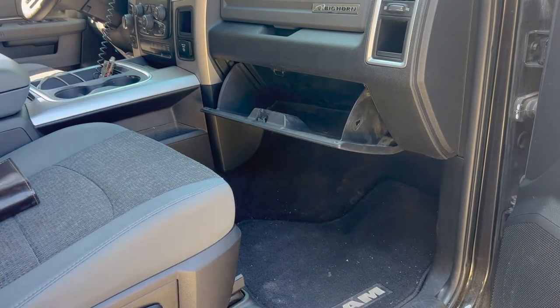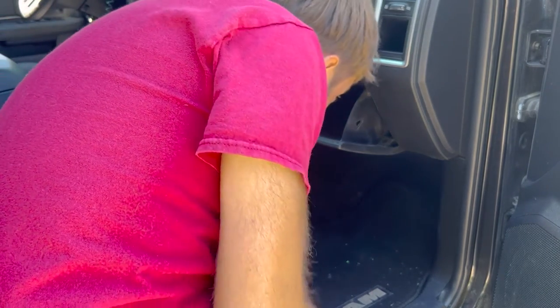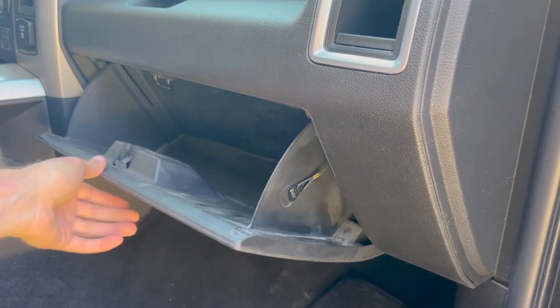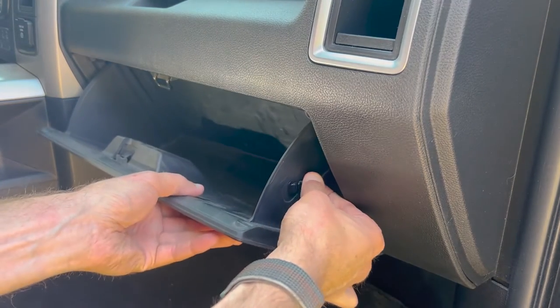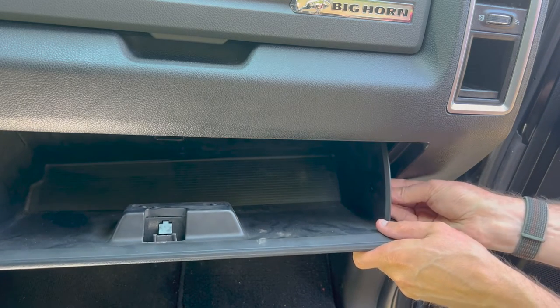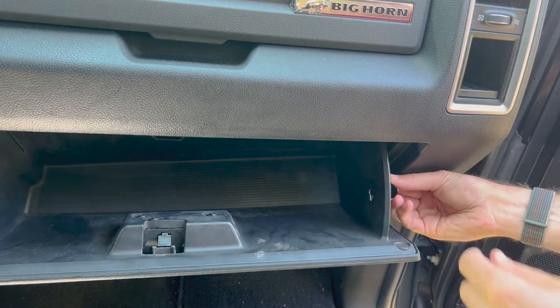Anything that's in your glove box, go ahead and take it out. You will probably have this soft-open soft-close rope or wire arm on the right side. To release that you should just be able to lift up the glove box a little bit, slide it towards you, and pull it out. Here's a shot of that same process from the inside — you can see it just pulls right out.